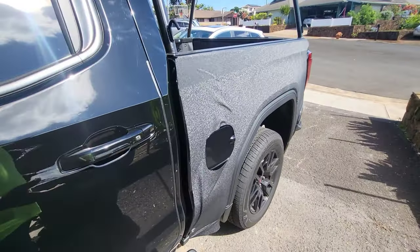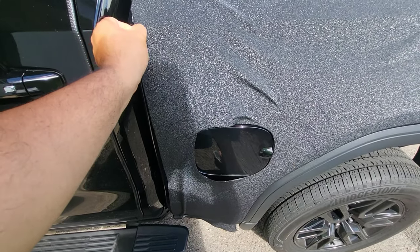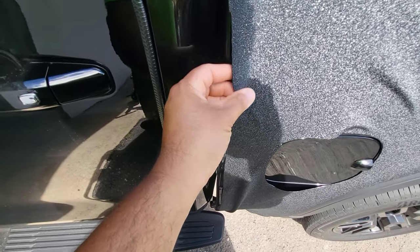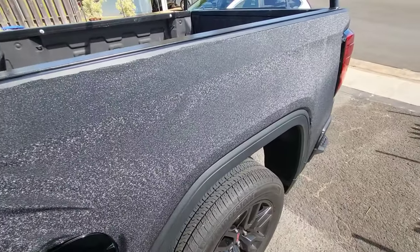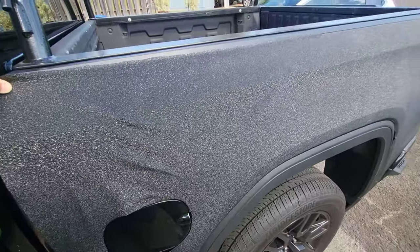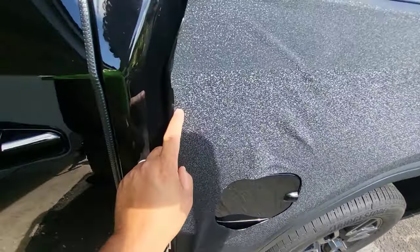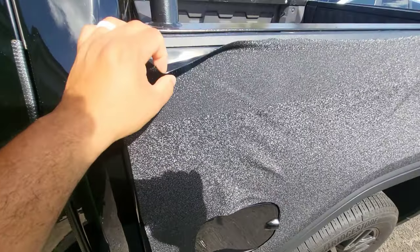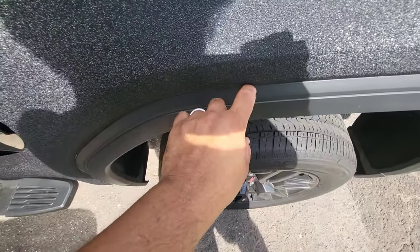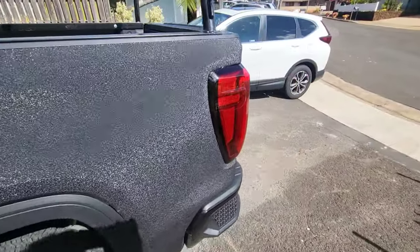That's the update — installation wise it goes on pretty much like regular vinyl. The only difference is when you heat it up it doesn't really mold too much since it's so thick. Look at that — even if I tried to rip it and I'm pulling really strong, nothing's happening. That's the plus side of this, that it's so thick and durable. I would put it knowing that you're not gonna be able to do any tight turns. This one went in clean because it lifted up so that looked clean, but down here we didn't take this off — we just tried cutting it — and then you run into stuff like that.